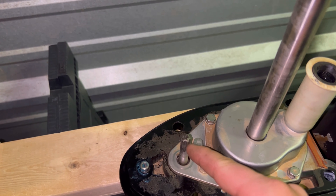Now that we've confirmed it's in gear, we're going to grease up our splines on everything. Also throw some grease on this stud and grease all your bolts. And don't forget about this piece — this goes on here and guides that shifter into and onto the lower unit. Don't forget that; you're going to have to have that.